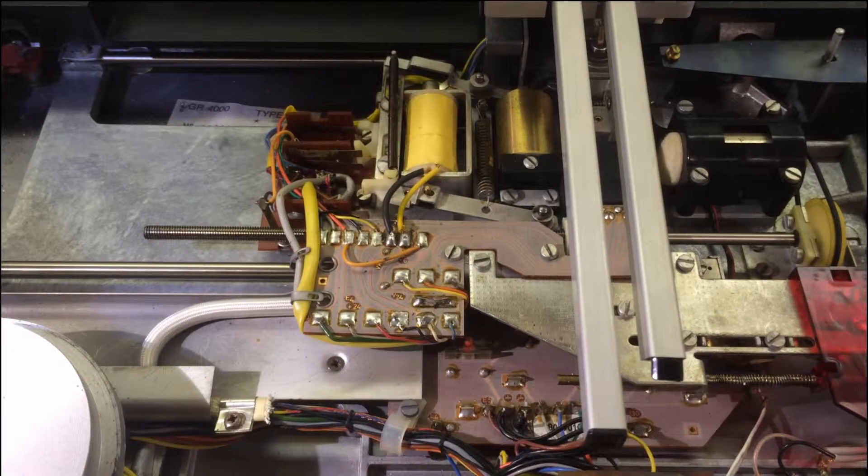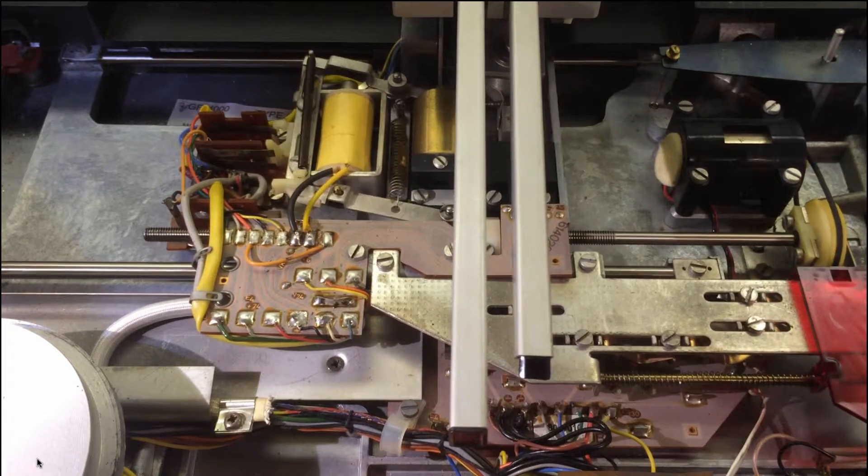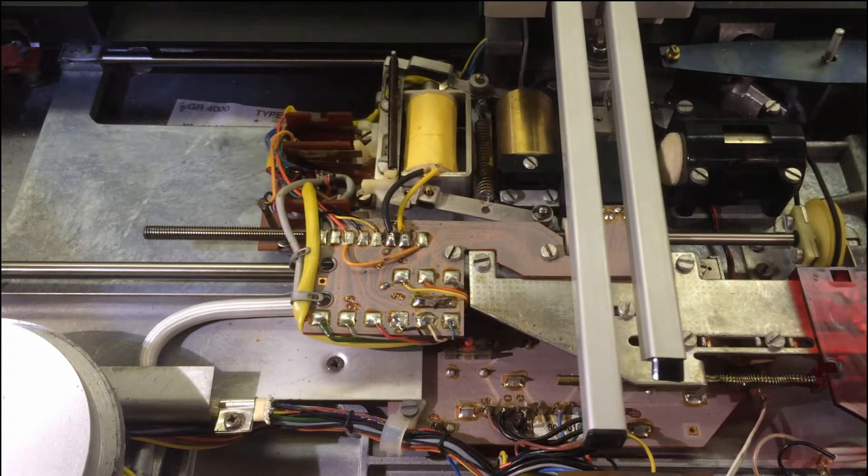Let me give you a quick demo, so I press start and here we go. What happens here is the carriage went into the position for the lead-in groove and then the solenoid started oscillating. So it didn't just go down as it should to lower the tone arm.